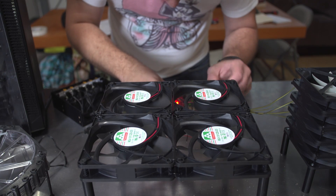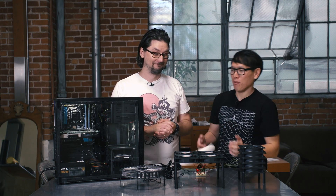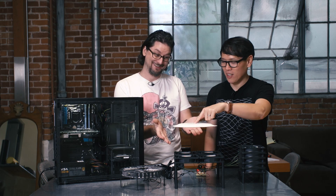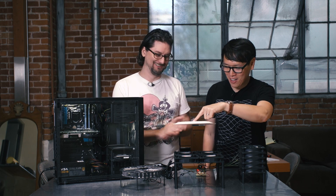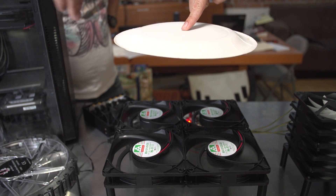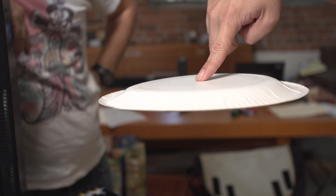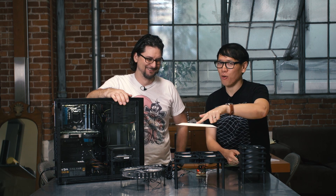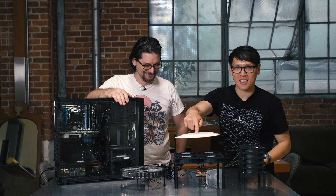And finally, a matrix of fans — two by two. That's a lot of air movement. We went a little old school here; these are not your typical case fans. These are 3,300 RPM and you can hear them, but it's moving a lot of air. So there you have it: negative air pressure a little more effective than positive air pressure, and also an array of fans more effective than one big fan or definitely a stack of fans. No stack of fans. We'll see you guys next time.